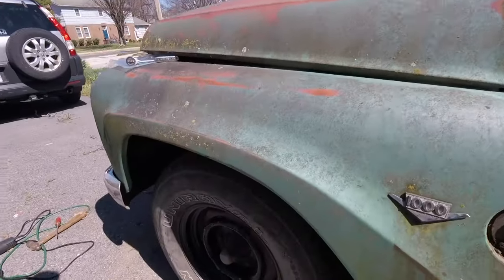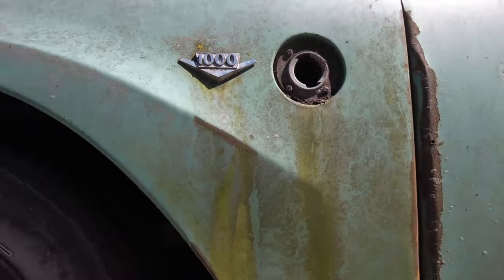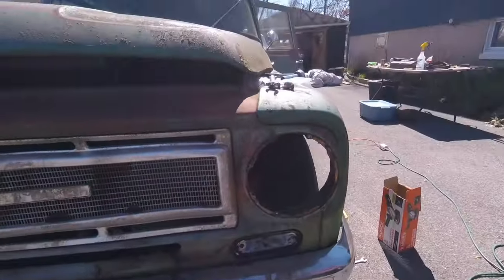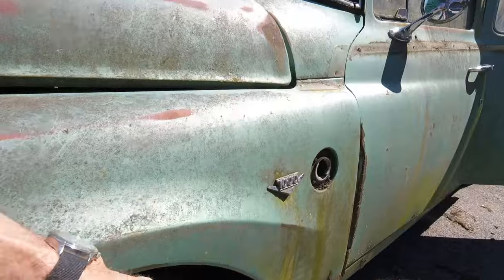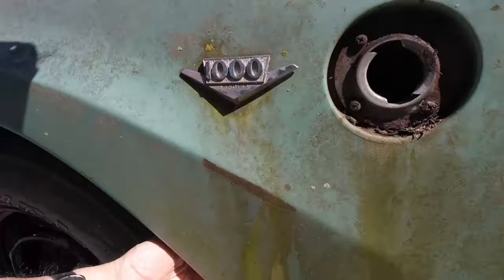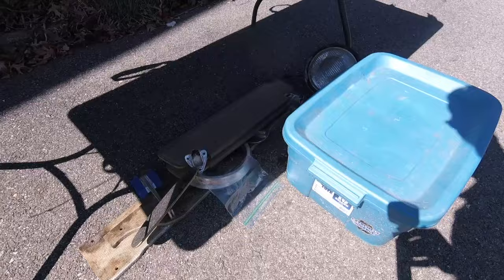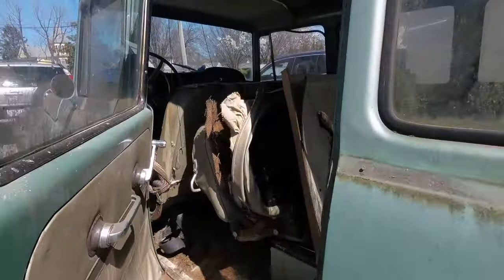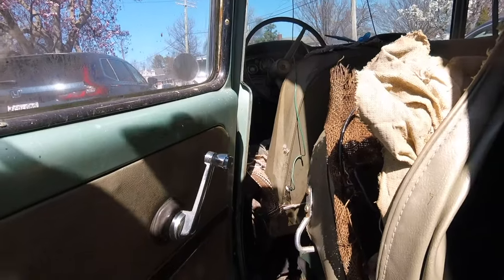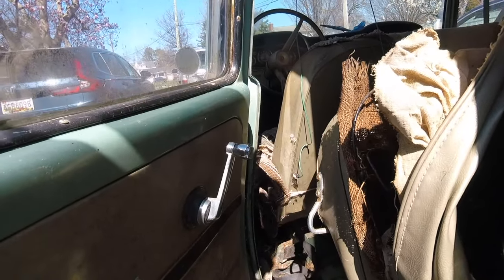Saturday morning working on getting the first parts off the truck - taking small stuff from the outside right now. I've gotten the trim off, the kick plates out, and hit a bunch of stuff with PB Blaster, trying to get the big stuff off and then the small stuff inside. The fenders are a challenge because there are all sorts of bolts up here and around here. There's a bunch of gas tank stuff in the way right up here. I started unbolting a door completely and realized I need to bolt it back on and leave it in place until I'm ready - the doors and glass will probably be one of the last things. Just got to slow down and be smart about what I'm doing.